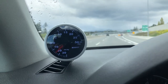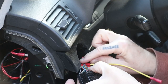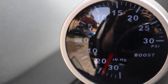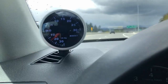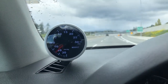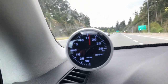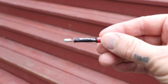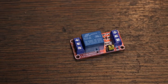The pros: the gauge works — it shows boost pressure and is immediately responsive to throttle input, and it was fairly easy to install. The most challenging part was finding the correct headlight wire, which required a few hours to pin out the headlight plug and build a spreadsheet. The cons: the smoked plastic cover is convex and super reflective, so during daytime driving reflections can interfere with reading the gauge. There is a slight rattle from the gauge's diaphragm, but under normal driving I don't notice it. The biggest con is the backlight — it's way too bright with a very blue-tinted white LED, and the headlight dimmer barely dims it at all, making the gauge super annoying at night. My solution was to insert a 200 ohm resistor on the power side, which dims it enough for night driving, but now it's too dim for daylight. I'll cover solutions to fix this in another video.